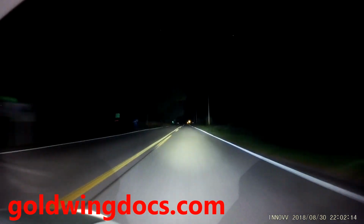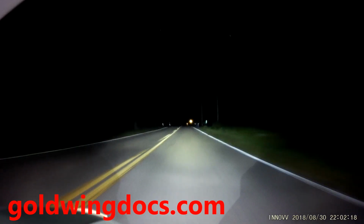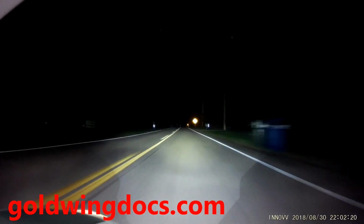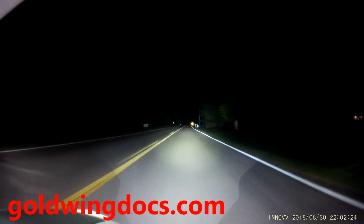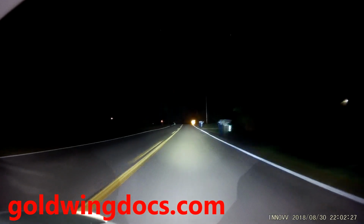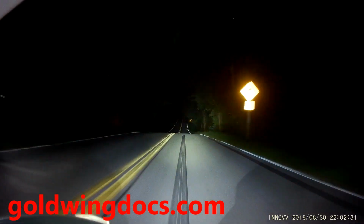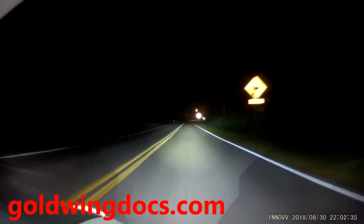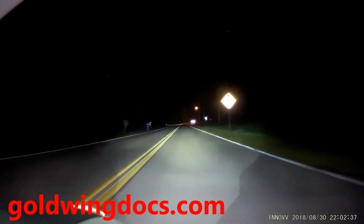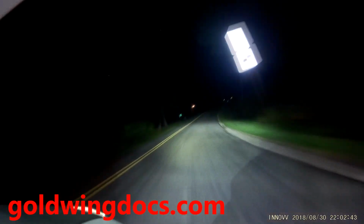Now I turn on my driving lights, which are two 30-watt LEDs mounted under the fairing, pointed fairly close at the road as well as off one side to look for deer. Notice when I have the low beams on, the driving lights fill in the dark inverted V, and when I have the high beams on, they fill in and light up the road close to me, which otherwise has less light available. While the Electrical Connection LED headlights are incredible on their own, the addition of the driving lights just makes the entire lighting system just that much more capable.